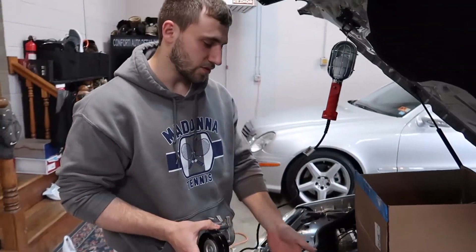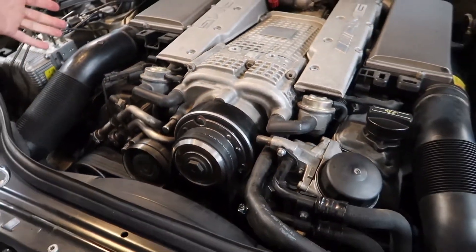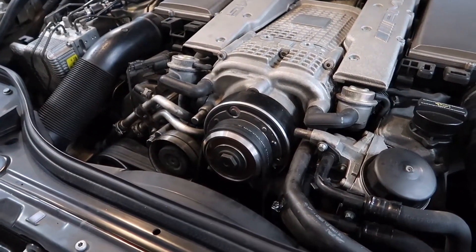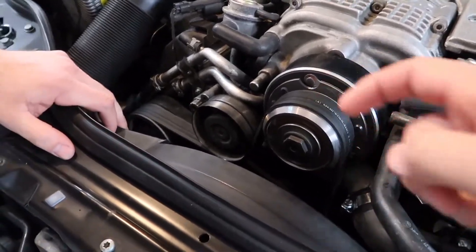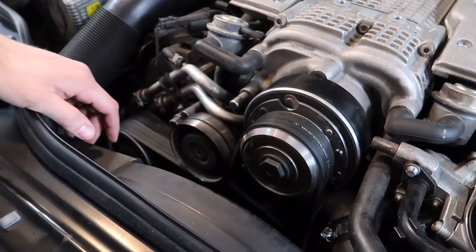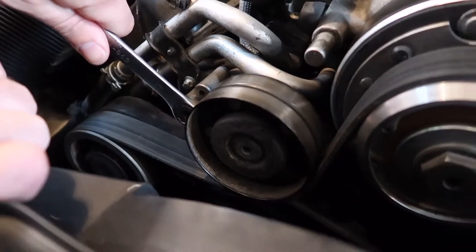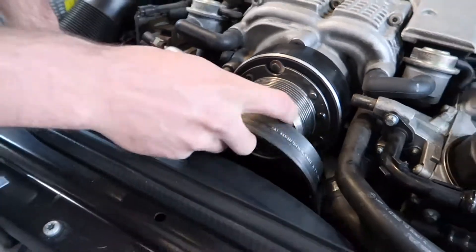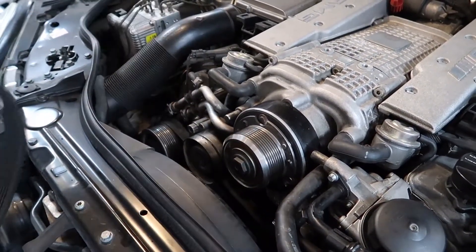Now I say we show them how to take the belt off next. First things first, obviously you have to take this cover off the front of the engine, which is super easy to do. If you can't get that off, then you probably shouldn't be doing this job. But first thing first, you have to take the supercharger belt off. And to do that, you put this 17 millimeter wrench right here and pull on it, and it's going to loosen up the tension on it. That way you can squeeze this belt off and take off the pulleys. And there it is right there. So there's step one. That wasn't too bad.